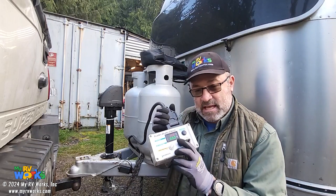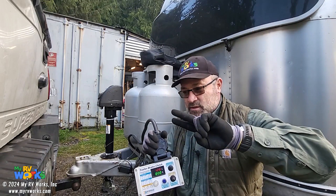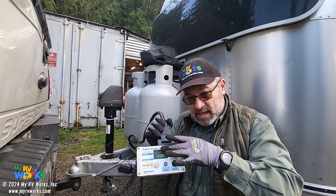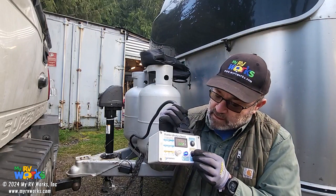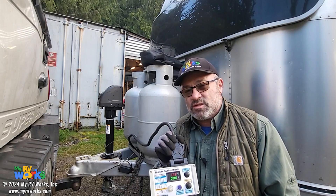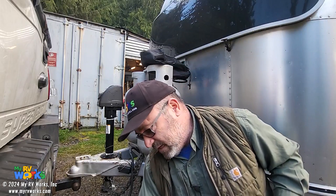When I first did this test I had the blue light. After I fixed the wiring problem — they had the brake wire and the 12-volt auxiliary power wire wired backwards — I connected this and got my display. I only got the blue light when I triggered it up, which tells me only one of my four brake pads was reading. So I had to go to each individual brake pad and do a test on each one.